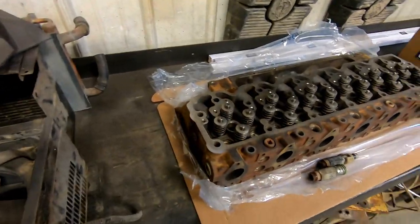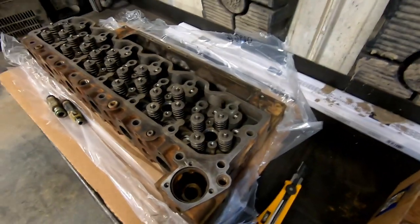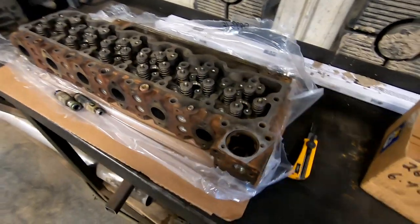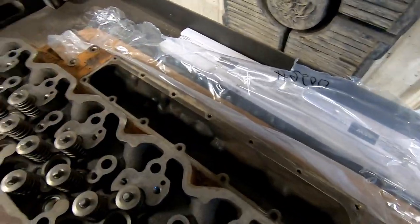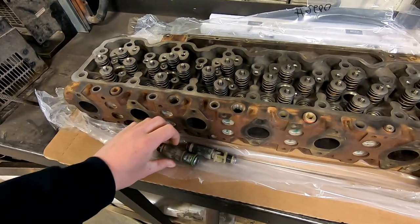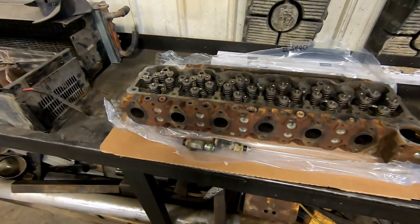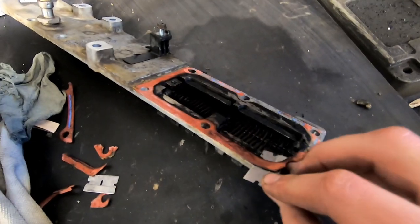Down below I'll put fast-forward times so you can skip ahead. I got the cylinder head back — it's all pressure-tested, resurfaced, clean, and good to go. First thing I'm going to do is dress this cylinder head how it was when I took it off the truck: put the lifting hooks back on, put the grid heater in with a couple bolts. Clean up your grid heater before you put it in. I'll leave a few things off until it's back in the truck so it'll be easier to tighten once it's secured onto the block. Just scraping off this gasket right now.